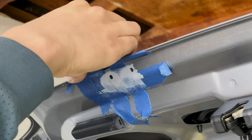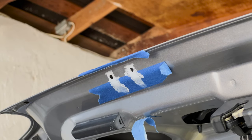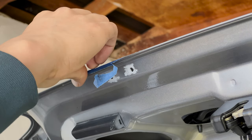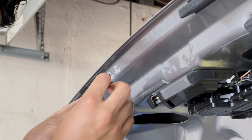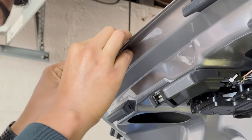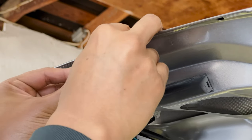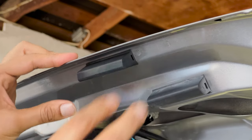As you can see, I didn't do the cleanest job, but it's totally okay. I learned my lesson, and if you're watching this video, you can do a better job than I did. I wasn't too worried about the overspray because it actually gets covered by the trunk stopper anyways. To close out this first part of the install, you're going to get the stopper and insert it into the holes that were drilled. Make sure that the long side is facing the trunk, then do the same thing on the other side, followed by a quick test to see if the trunk closes properly.